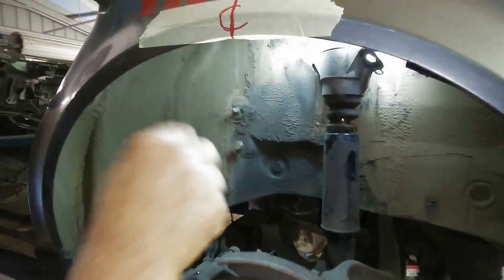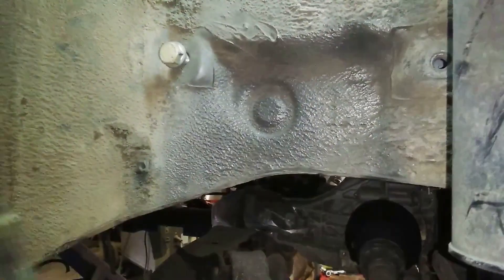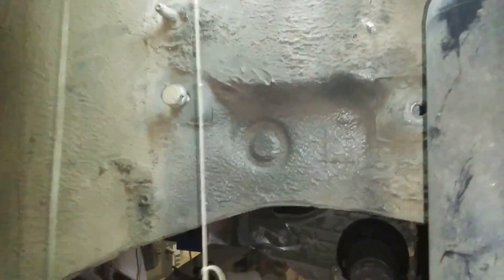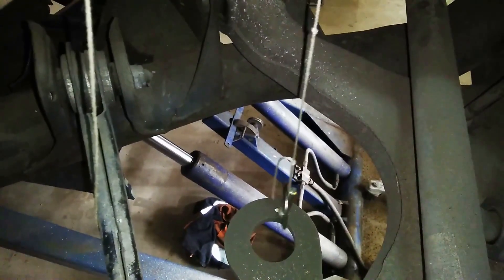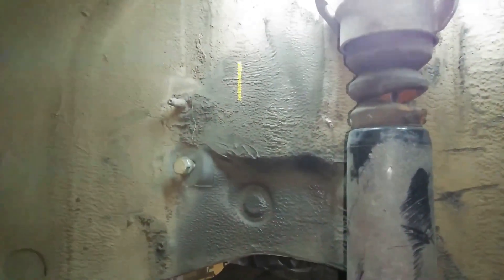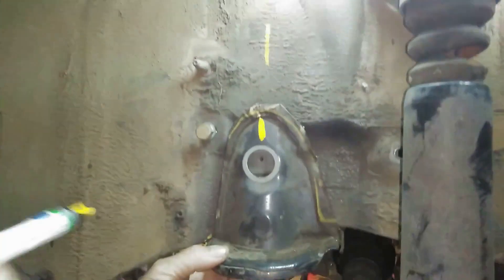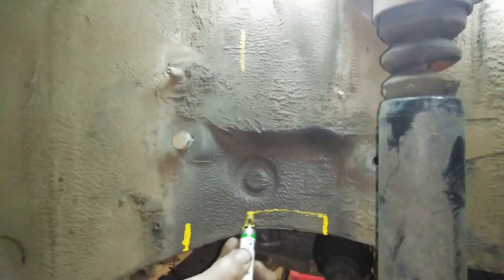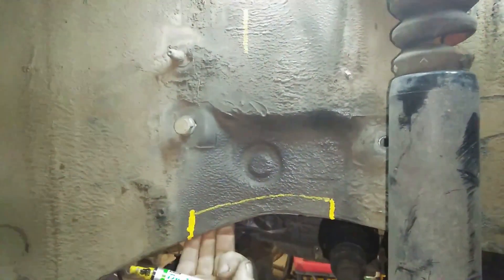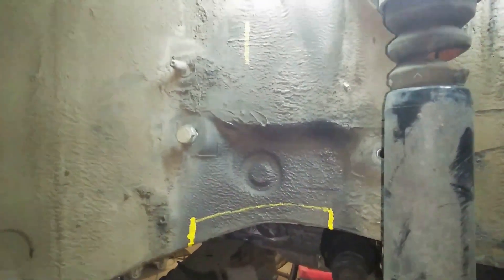All I'm doing now is setting up the top of the spring tower. Once we've cleaned it up, it's going to weld in here. Not rocket science — it's just a case of centering our plumb bob to where the spring goes and making a mark. A quick mark up here for our centre point. We then bring our tower in — we've got that basically lined up in the centre. We've got to cut the chassis a little bit down here in order to make this fit. This section of the chassis will come out because it's basically a hollow void behind there. We'll cut the seam out — that'll give us a good, strong, sturdy surface to cut to. It's amazing how the shock almost lines up with the structural element of the front wheel drive.